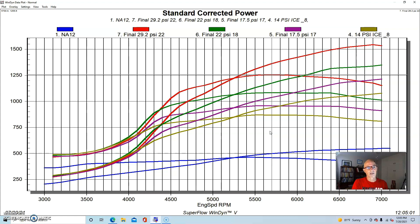Ice water does very well and we were able to turn the boost up quite a bit — up to 29.2 pounds — making over 1,500 horsepower on the stock bottom end, which is very impressive. If I were to redo this test, I'd like to see more flow through the core, both more water flow and more airflow, which would necessitate either a bigger single core or dual cores with more flow rate. That's another test for another day. I'm Richard Holdner — make sure to like, share, subscribe, ring the bell, and I'll keep testing.